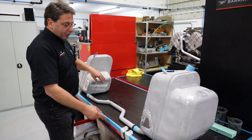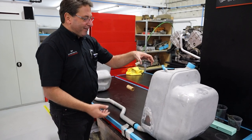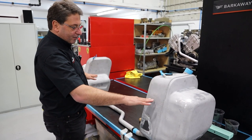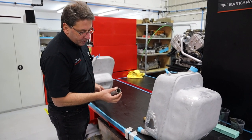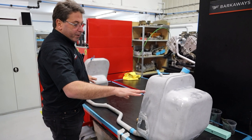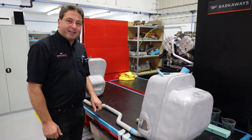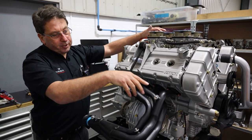You go around another roundabout the other way and it all goes out through there, fills the other one up — because these are linked by air pipes over the top. So this one becomes full, this one now reads empty and your light comes on. The only way to know really how much fuel you've got in one of these is when you're in a straight line and level — not doing corners — and it sort of finds its own level. So when you're in a straight line, you take an average of where you are. When you're on corners and fuel lights are coming on, it is a bit disconcerting, but that's why it does it.